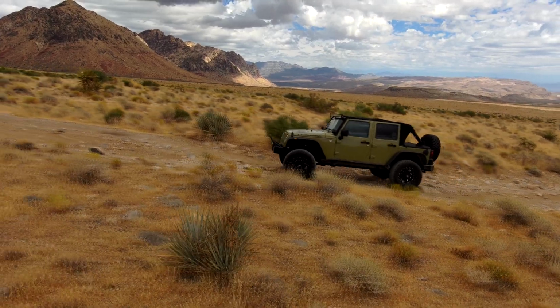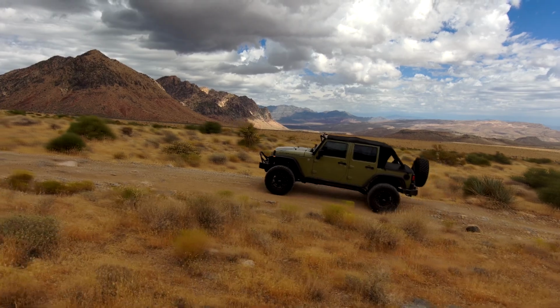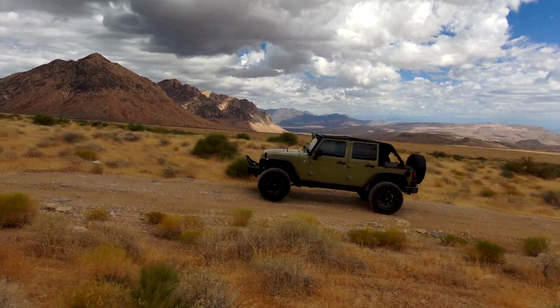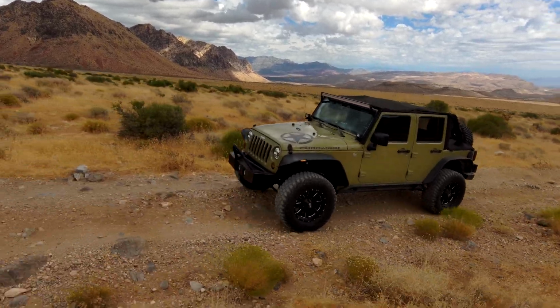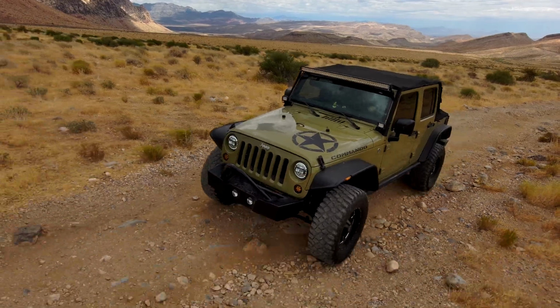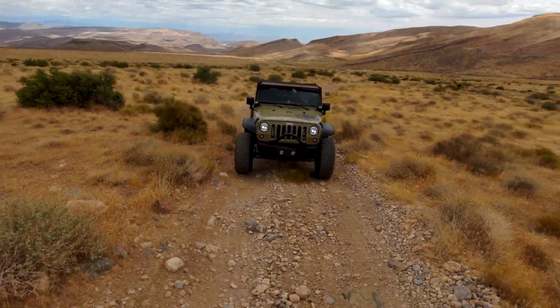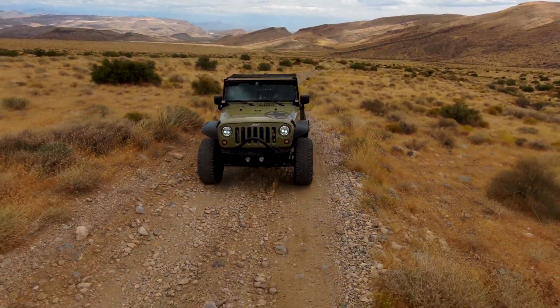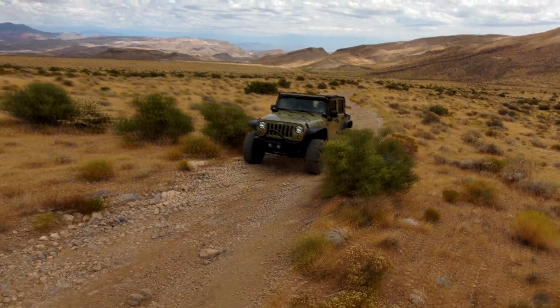So the new trend in these Jeeps, and it's been a trend for a long time with the military and exotics, is just to get multiple coolers and put them everywhere. Yes, it costs more and it is more complex, but by shedding that heat into the atmosphere, you're not putting it into the radiator and then into the engine compartment, which you have to try to get rid of. So I think the first line of defense would be the rock rail cooler for the transmission.